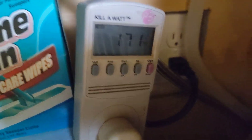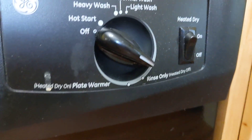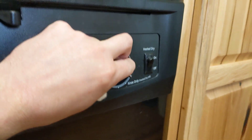We have a wattmeter hooked up here, and the machine is currently consuming 171 watts. It's getting close to the end of the wash cycle, but while it was running it was consuming around 690 watts during the main wash cycle. I assume there is a temperature-sensitive switch inside that will prevent the heating element from operating if the water is too hot — I think that would be a safety feature they'd have to include. Right now the water is obviously hot enough, or the controls just aren't in the position to activate the heat.